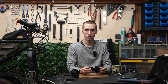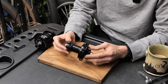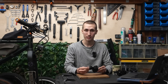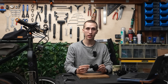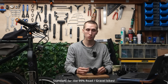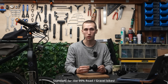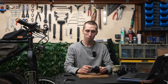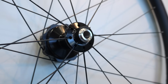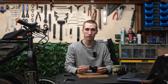Whilst looks aren't everything, it does suit a more sportive bike even better. Up to now you can only get the new model in black. SON offers their other models in various standards fitting many different bikes, but the 29S fits forks with an OLD of 100mm and a 12mm through axle. This version also uses straight pull spokes, which is something more commonly seen on road or gravel bikes.